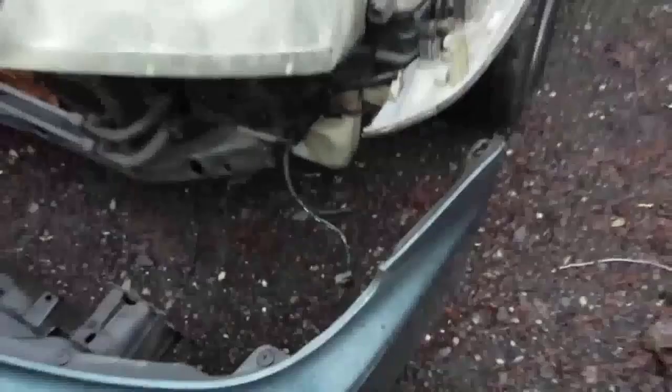And that's how the bumper comes off without having to do all the stuff that other videos are showing — like stretching plastic around, trying to run your hand up in holes, or even breaking things. I've seen some of them show breaking the headlight, or removing the grill, and just a whole lot of extra stuff that's not necessary. Just follow this procedure. It's basically a few bolts — retaining bolts and clips that hold the front bumper cover on. Remove those — that shouldn't take more than 5 to 10 minutes. Then take the marker lights out, run the two bolts out, and drop the bumper down and it's off.